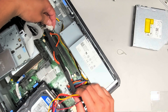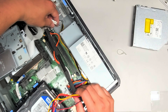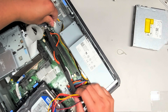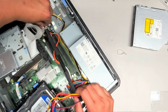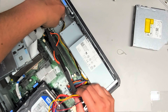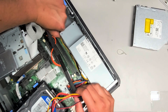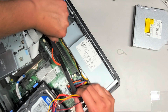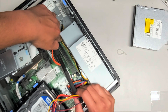Let's go ahead and plug this back in. The clip faces towards the RAM, so when you put that back, make sure you have it facing the same way. Put that in and click it into place. Just getting it back in the little hooks. It's not too important that you get this thing all routed — it just makes it look a little bit cleaner inside.